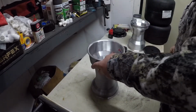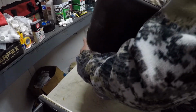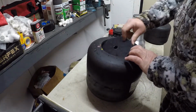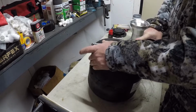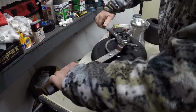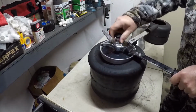That's one right side. Alright, let's do another one. Thin bead on the wheel up, date code up. I'm pushing the bottom bead on. Alright, put that plastic piece in there. Put that under the lip of the wheel, put the pan in, start stretching it on, spin it around, pull it just a little and push it with your thumb as you're pulling. And you can see how that tire pulls up under the bead on the wheel, and another tire mounted.